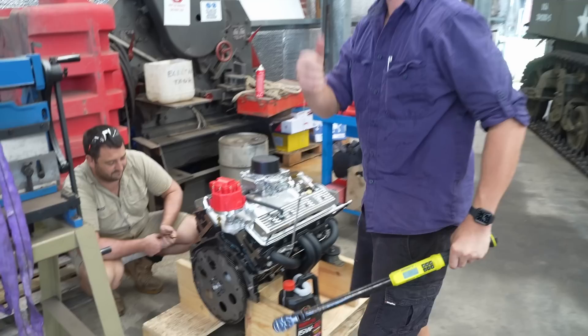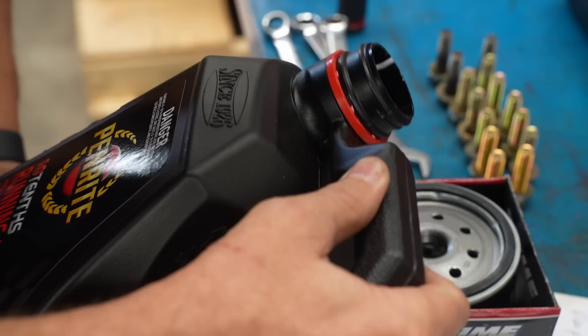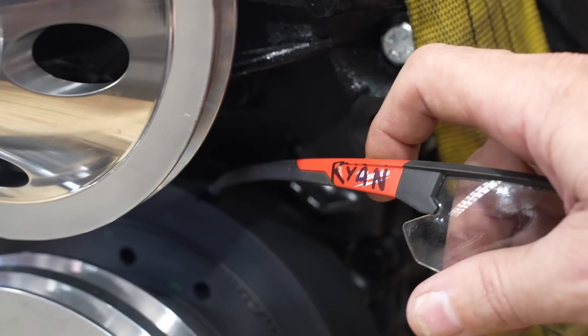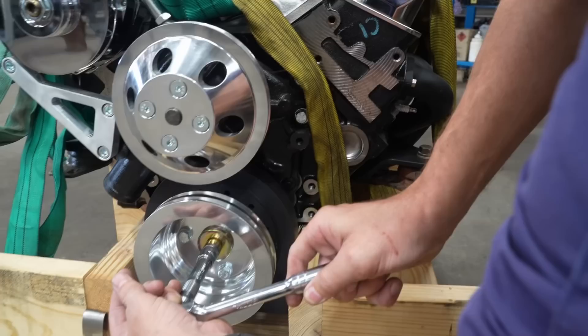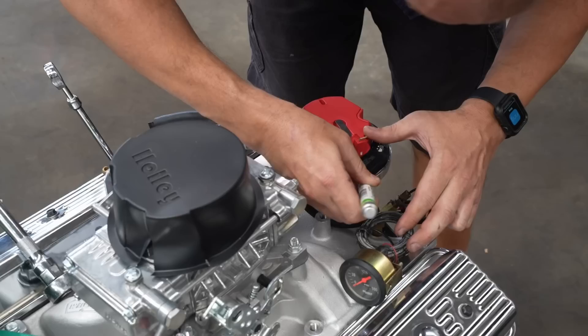Same thing as you saw with our crate engines — just got to fill them up. The surface is clean under here and that's the thread for our oil filter. Now I'm going to set the timing — I'll set it to top dead center. This is your top dead indicator on the timing cover; turn the crank to line that up and we're on top dead center. Cylinder number one is on TDC. You can be 180 degrees out and end up on cylinder number six, but as you can see we're on cylinder number one, pretty much right on the mark. I'll mark it on the manifold so when it goes back in it's in the exact same position as factory.